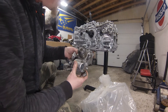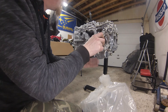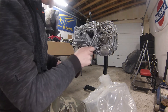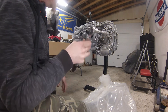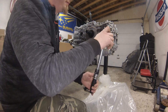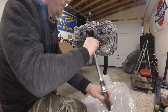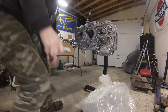I had a new water pump gasket from some timing kit — one of my old jobs — so I can put the water pump on. The water pump bolts are torqued A, B, C, D, E, F at about 8.9 ft-lbs. I've converted to inch-pounds — that's about 108 inch-pounds. And that's the water pump on.